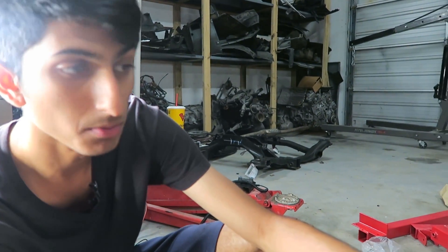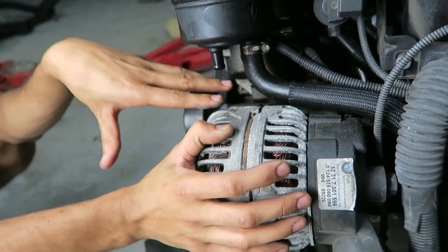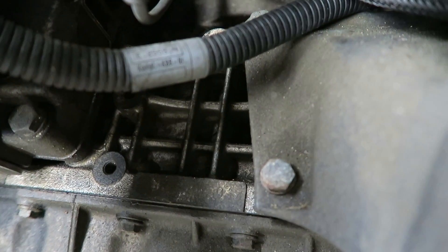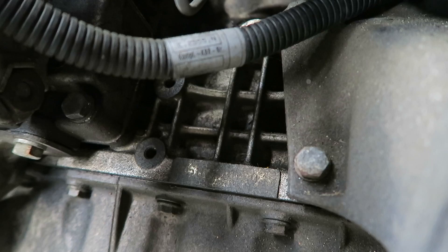The housing is only held in with a couple of bolts — I have a DIY on that on my channel, linked below. Remove those bolts and replace the oil filter housing gasket; the gasket itself is about four dollars. You'll see drops on your driveway, and you can also diagnose it by removing the airbox and looking through the hole right here — you'll see oil puddles on the waffle-weave structure, which means the gasket is bad.